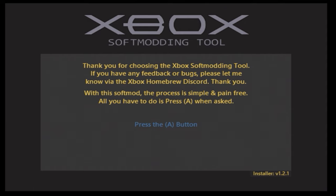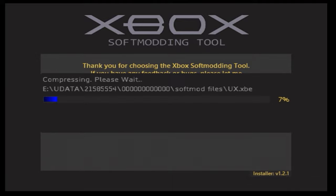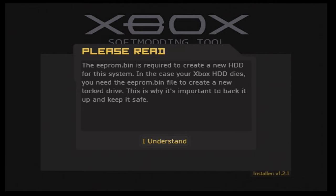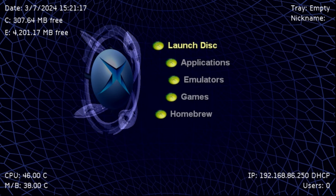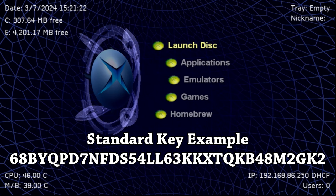For anybody who does not know: the original Xbox has an internal hard drive. One specific thing with this Xbox — if you have a stock system or even a soft-modded one — is that it will run a retail BIOS, meaning the hard drive paired to this system is going to be locked to this specific system. It only unlocks once it's booted up properly on the accompanying motherboard. That's why if you upgrade or replace the hard drive on a soft-modded Xbox, it must be lockable and locked with that specific key to work on the motherboard it's paired to.